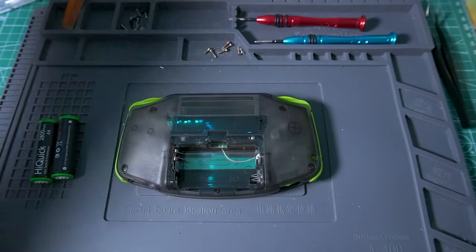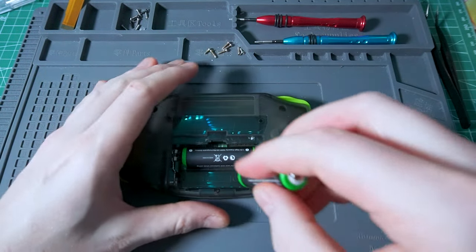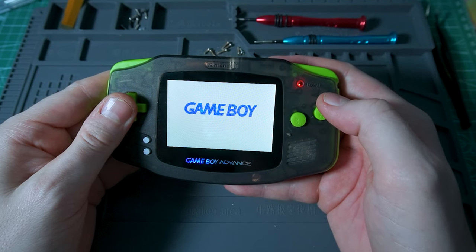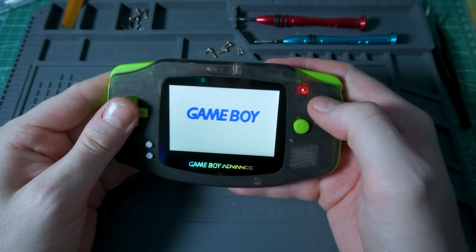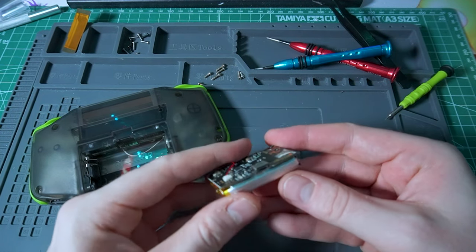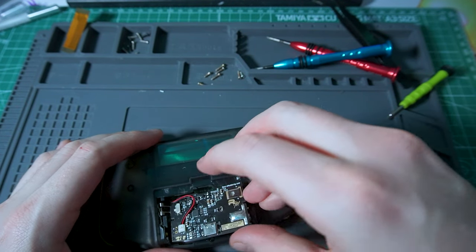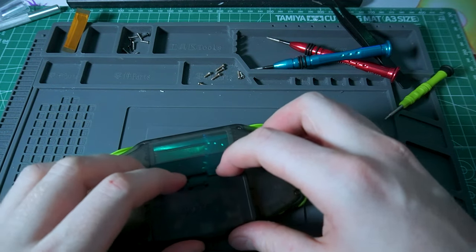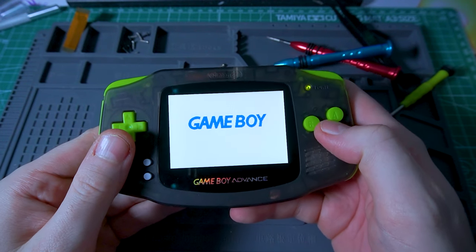I'm going to use rechargeable batteries to test it out but that's really only for testing purposes. She's working! As you can see the light button is completely freaking out — that's because these batteries are just not enough for the screen; it uses a lot of power. So that's where the second part of the mod comes in. Taken straight out of my other GBA, it's the USB-C Lithium Ion battery mod from RetroModding.com. This is an all-in-one drop-in battery you can use on any Game Boy Advance without any modification to the shell. And yeah, this is amazing. Look how easy that was.